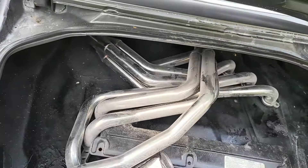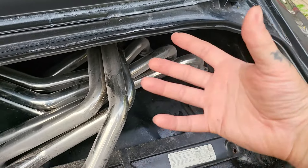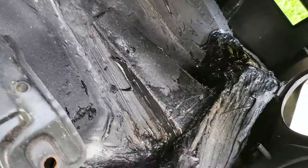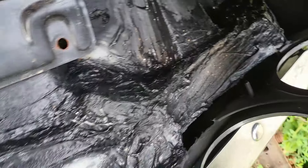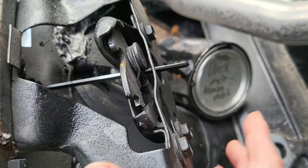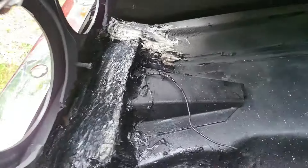People say that you need to change the trunk pan. Well, you do — the trunk pan needs to change if you go in for a factory clone. But if you just don't care, you can extend your trunk with build extensions. That's seam seal on top of this, like was done here. Leave gaps to get to your bumper bolts, like was done here. All this was built. This trunk latch here is factory 1979 — this has not changed, it works perfect. Seam sealed and built up, and that's all you have to do.